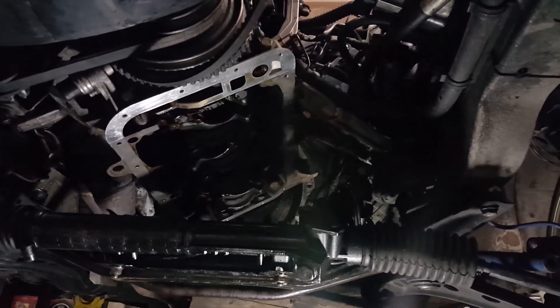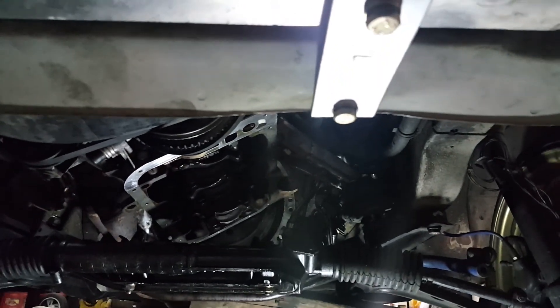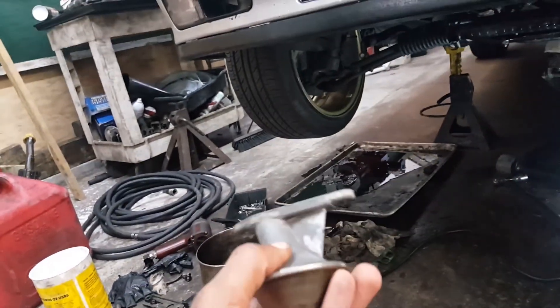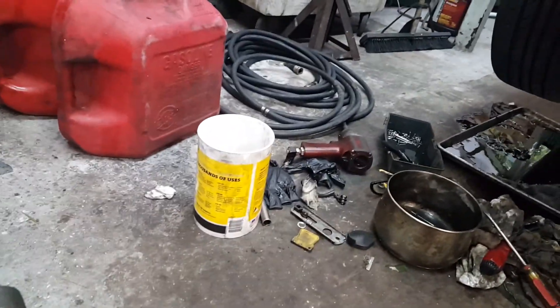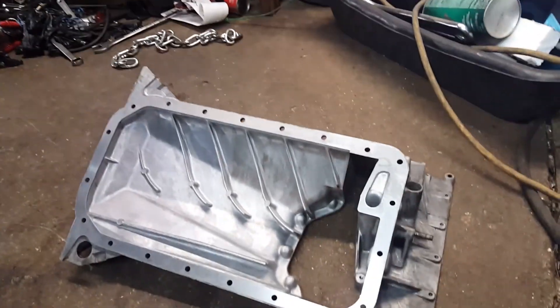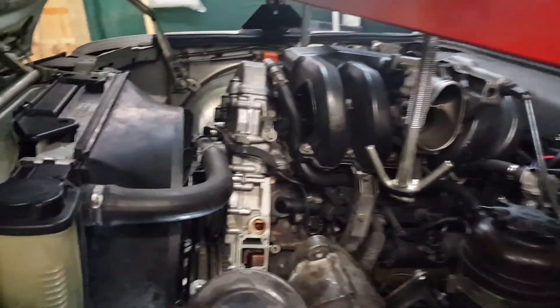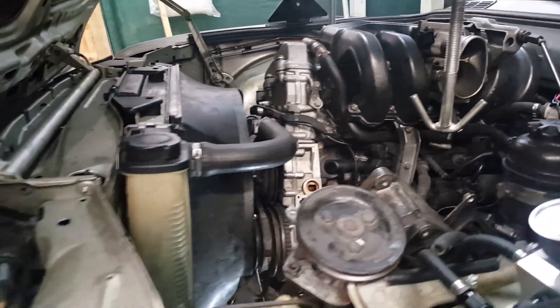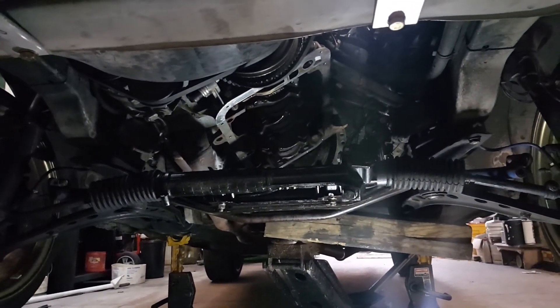Alright guys, I got everything cleaned back up. I'm going to apply some silicone to the upper oil pan, then install the gasket, and then reinstall the upper oil pan. I still have to wait because I forgot the gasket for the oil pickup. I also need a seal for the oil filter base — I got the gasket but I forgot the seal. I took these over to my dad's friend's shop so I could use the parts washer and got everything cleaned up. I also decided that I'm going to install the turbo, so that will be in my next video — look out for that.